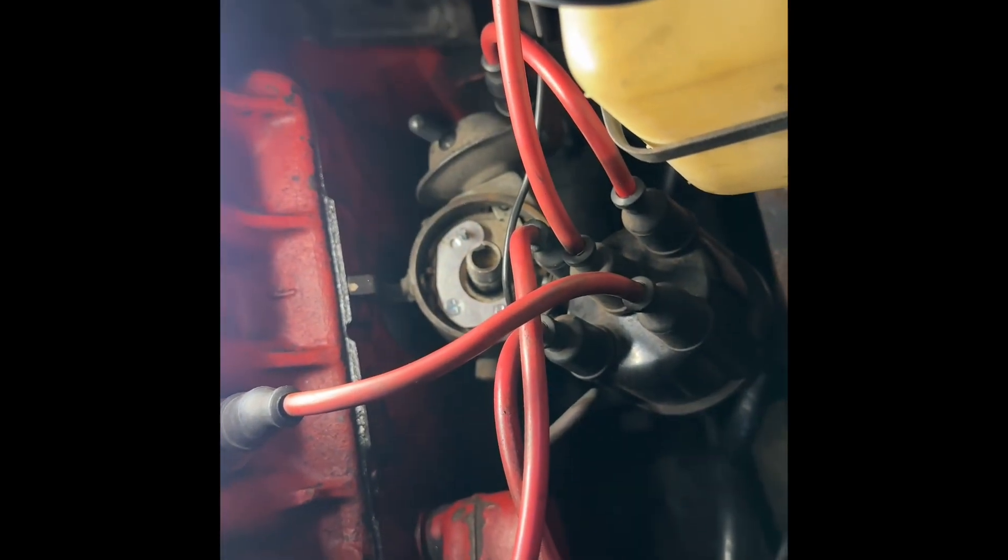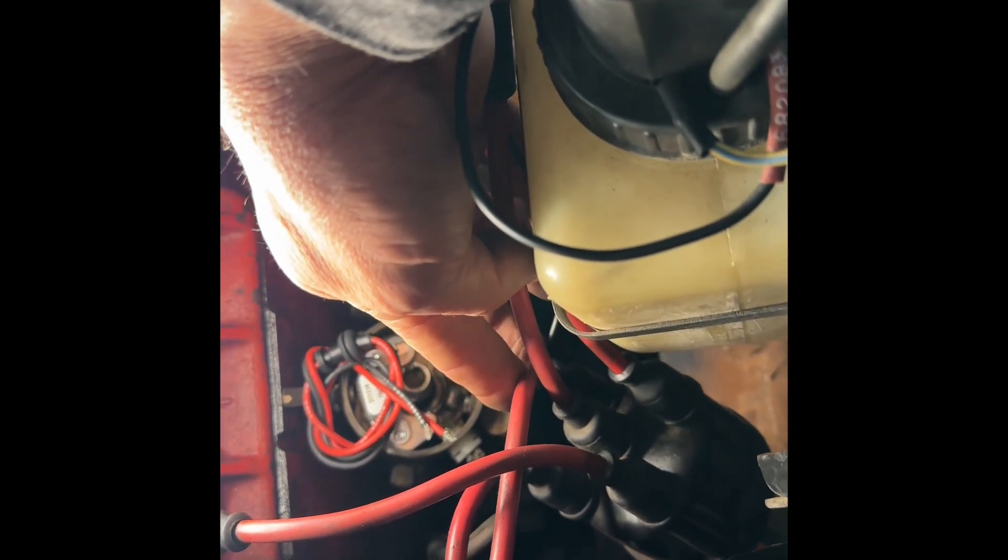I've replaced the base plate screw with the one from the package - nice and flat. The electronic pickup is going to clip over like that, and I'll run the wire through. My next step is to pull off the condenser and that wire, then route the new wire through that hole and secure the electronic pickup using those two little nuts. It also works with the vacuum advance - as the vacuum advance moves, it slips around to advance or retard timing.